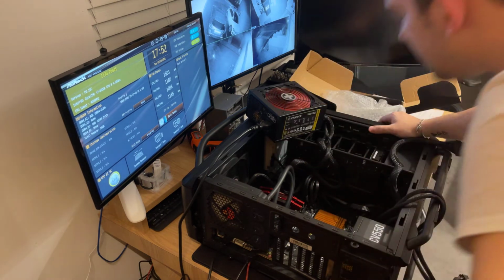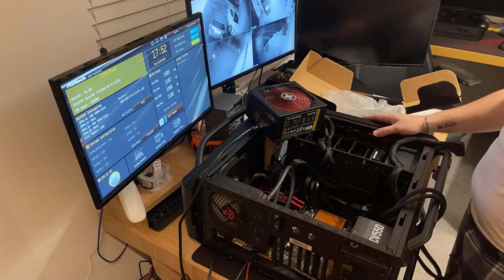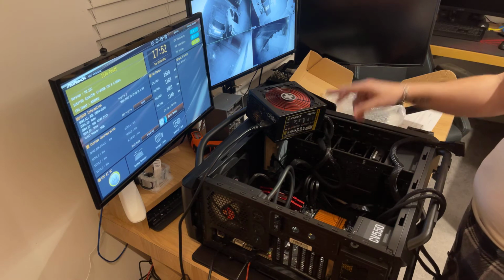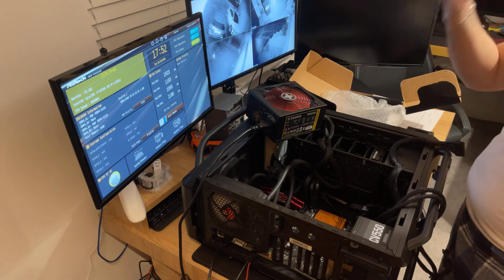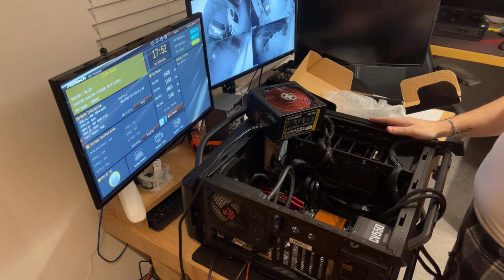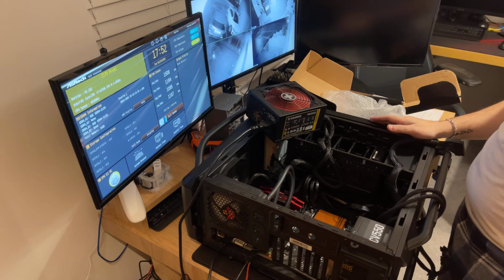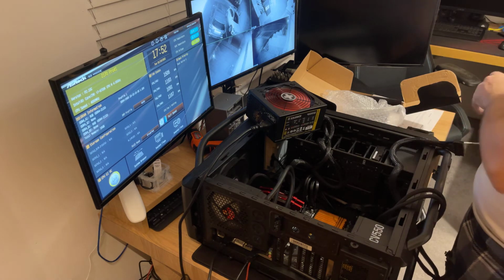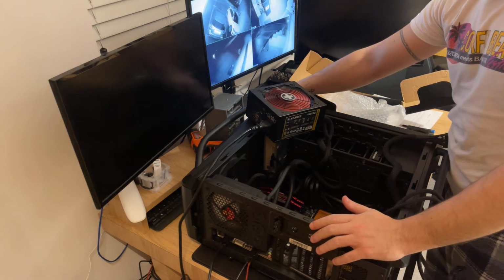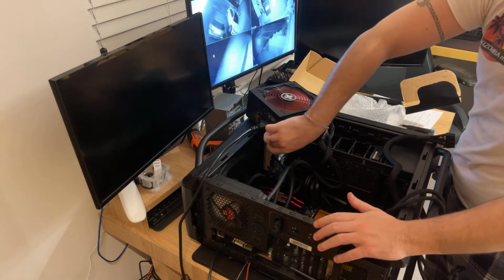Interesting one. So, it's either the graphics card that is dead, or is bringing... Well, it can't be too much power, otherwise it would have worked with this one. It might have shorted that slot, so I'm gonna try it in the other slot as well. And I'm gonna try it with an extra graphics card to see if it still works with a different graphics card. So, let's turn this off. And off.